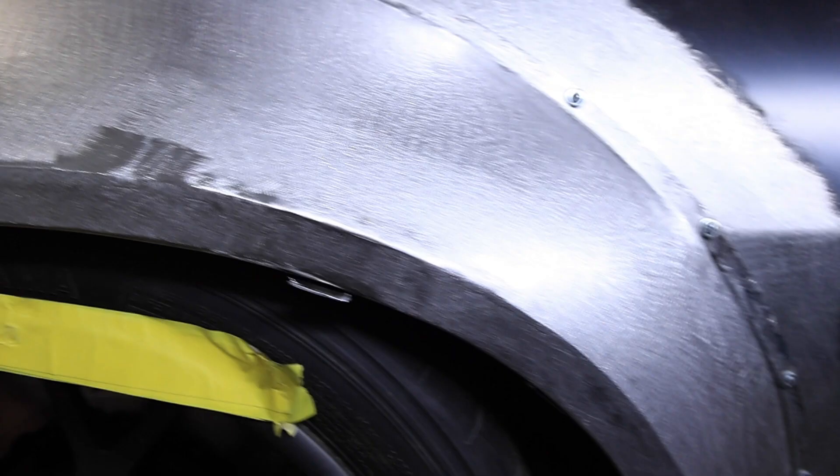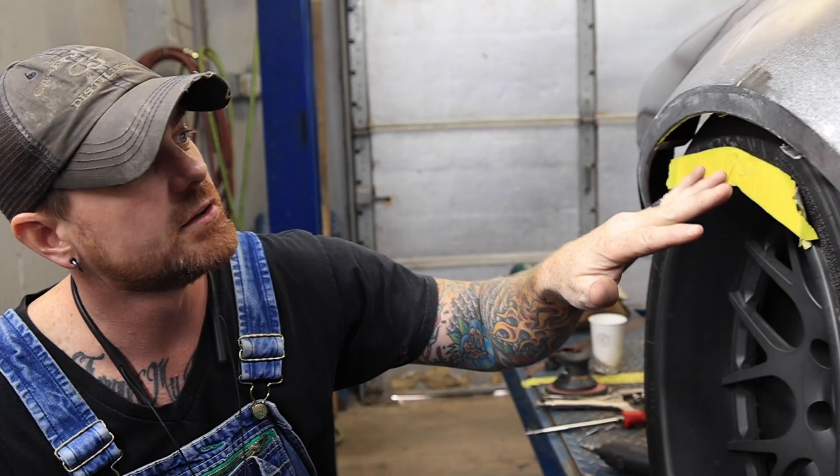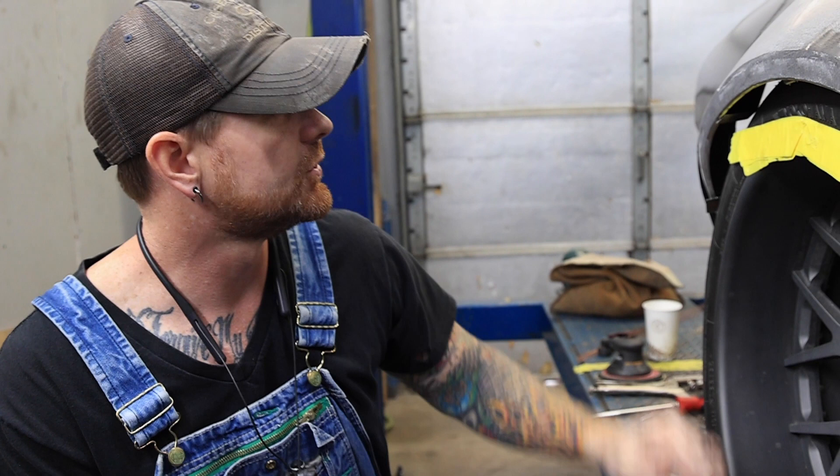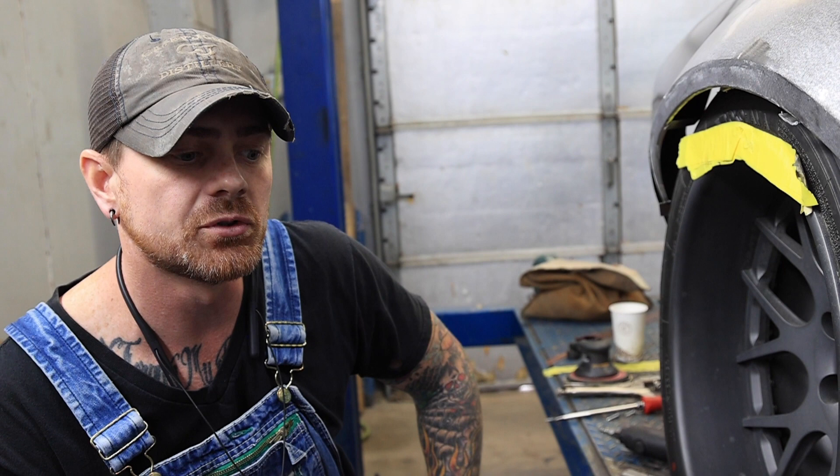We've started welding out and doing a lot of grinding on this edge. The seams on the sides from upper to lower sections have all been welded and metal-finished. We've still got a little left on the front, then we'll start metal finishing — using a sanding block to find highs and lows and bring everything to a smooth, uniform look. Everything's been welded and DA'd with 36 grit to remove most grinder marks. We'll use a blue die to show highs and lows, then block-sand with 80 grit to reveal what's at standard level versus high or low, then hammer and dolly our way to something consistent throughout the shape for a better start on body filler.